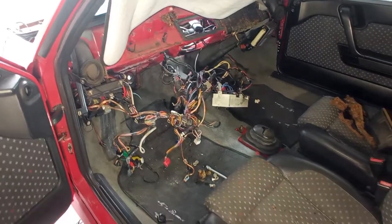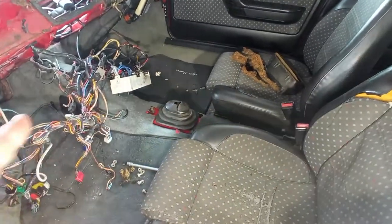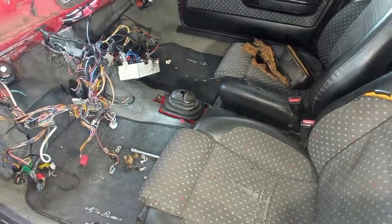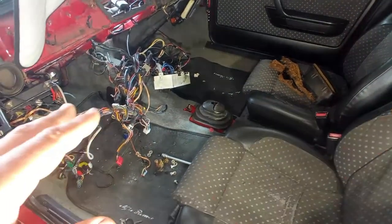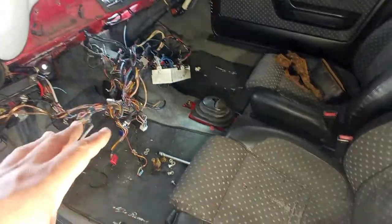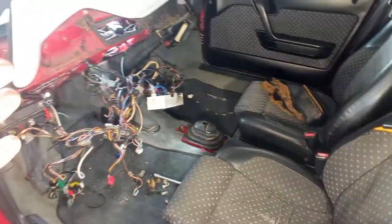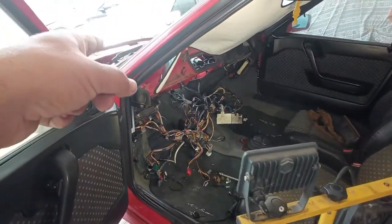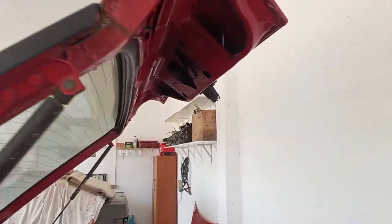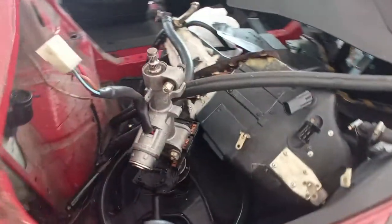So I'm thinking here about the next video. It will be a video for the floor, and the front seats are very normal to take out, just four bolts on each. But I will show you anyway, because there is a tip or two for that. And removing here the cloth on the floor all the way until the back. And in that way, we are able to remove the entire wiring that starts over there on the outside of the car and ends up on the tip of the boot over here, and on the taillights also over here.